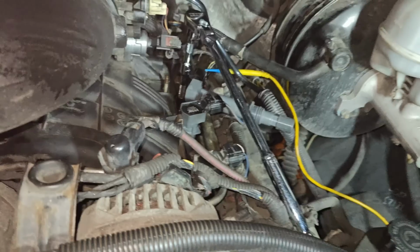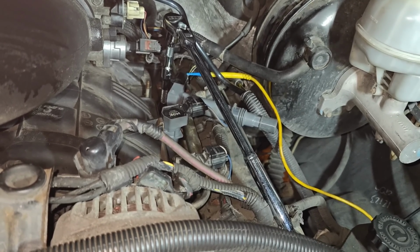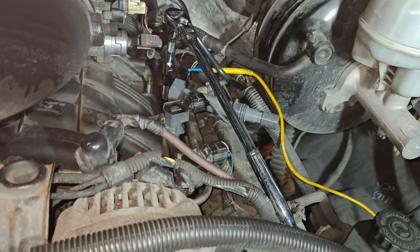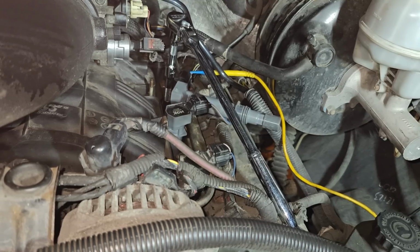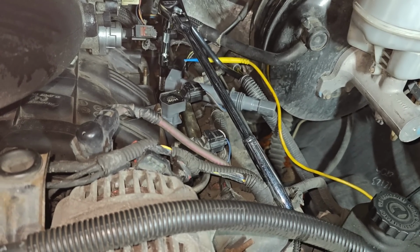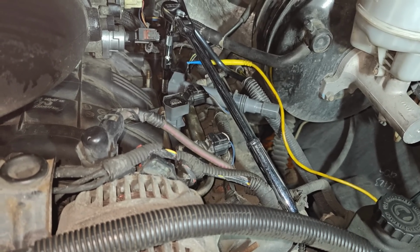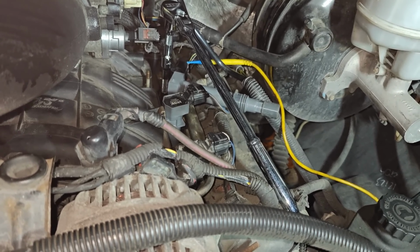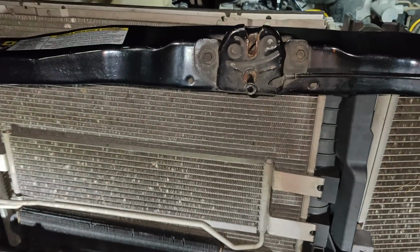And I just talked to the shop and they said they're trying to see if their one tech changed the spark plug or not. The other one said they couldn't loosen it even with a breaker bar. So yeah, they may have to pull the valve cover and see if there's a broken valve spring, because these things break valve springs. I've seen damaged push rods, seen chewed up cams, so we'll have to see what they want to do here. So I guess I'll release this as low compression.